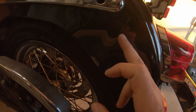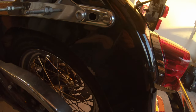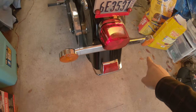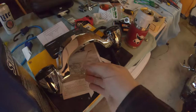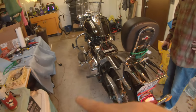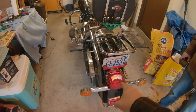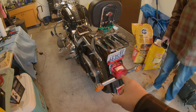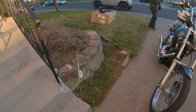There was a bit of an incident last year before he blew up his knee — they managed to MacGyver fix it on the road. He punted it with a size 12 or 13 motivator. So we're gonna get this out of here, replace his big ugly boat anchor taillight system — my opinion, not his, he likes that thing — with my takeoff from the Street Glide. We're gonna drop the plate here. He's got a tombstone taillight going on, keep the top plate setup, and put on the Advance six-inch stretch fender.